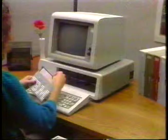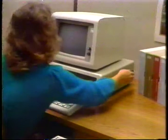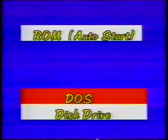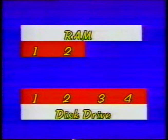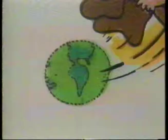Let's assume that you have put a specially prepared DOS disk into your disk drive. When you first turn the power switch on, the drive starts to run. Your IBM personal computer has a program already in its ROMs that automatically starts DOS. That program has just enough information to know where to look for a disk drive and how to read the first bit of data from a DOS disk. The first little piece of information is loaded into RAM, and all it says is how to load the second piece — the second piece tells how to load the third piece, and so on until all the necessary pieces are loaded. All the pieces together form the disk operating system.